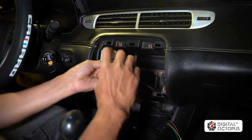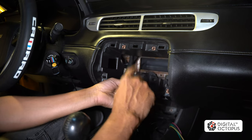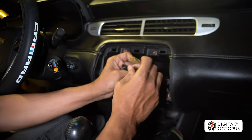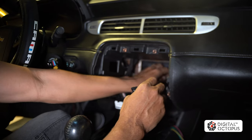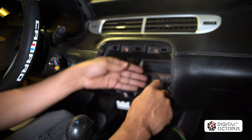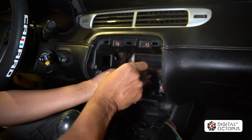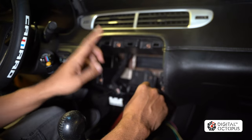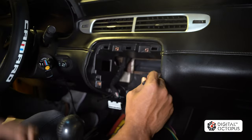We have the main unit harness and the AC harness — if your AC is not working it's most likely because this one isn't connected. You should have two antenna connectors: a black one for AM/FM and a brownish/beige one for your satellite antenna. If you have a MyLink system you'll have an extra harness for the rear-view camera. We have an adapter that's plug-and-play — you plug it into the reverse camera port behind the radio; I'll put a link in the description.